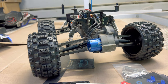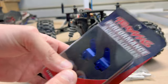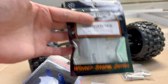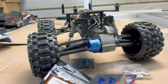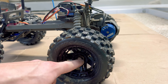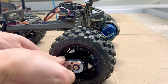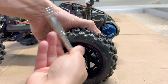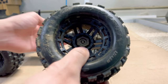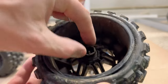So that's what we're doing in today's video. We're going to start with the back — replacing the rear hub carriers and drive shafts — then move on to the front. We won't need all of the bearings in the kit since the hub carriers come with bearings, so we'll have a few extra. Let me resituate the camera and we'll jump right into the installation. The easiest way to take the wheels off rather than removing the 17mm nut is to just take off the 8mm bolt right here.